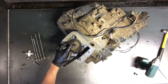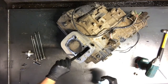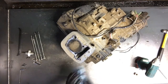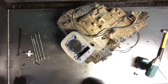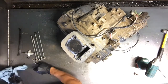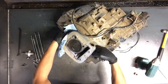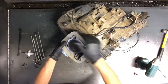Then we've got your cylinder here with your piston, the cam chain guide — we'll pull that out. This other one we won't be able to pull out until we pull that cylinder off. To pull the cylinder off, we just have one 5mm Allen head here, a little Allen bolt there. And then the cylinder is ready to come off — just kind of put some pressure on it. Don't damage the gasket area on your base gasket.